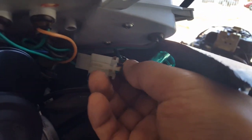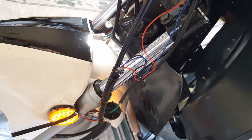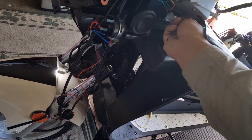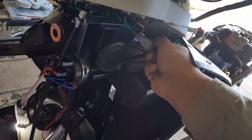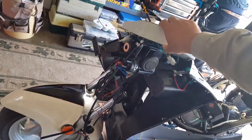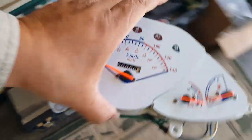I killed the engine. I think what's going to happen is maybe these wires get crunched or something inside, and that's probably what's causing it. I'm flexing it — I can almost control the signal blinker just by flexing this wire here. So these guys have a habit of going bad easily. Something has to do with a short or something like that. So now we know our gauge cluster is fine. We could keep our original one on there, but I prefer to go ahead and get the zero odometer reading and put that on so we know how long the engine's actually been driven. We don't think we took it more than 50 miles really.